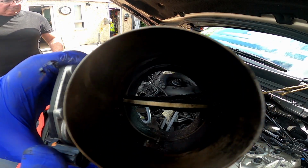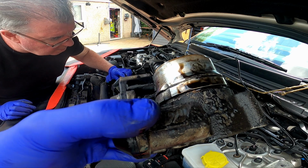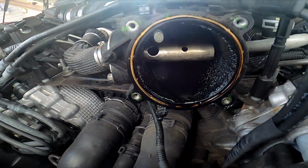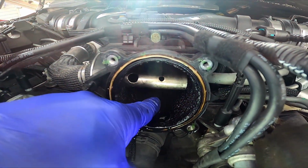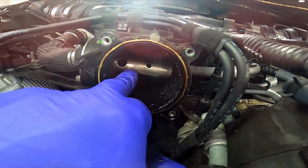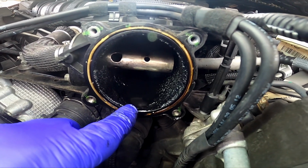If you can see that, quite oily, lots of carbon deposit on that side. Mother of mercy. So that's quite bad looking. And have a look in here, there's that light part, and that is oil. Now bearing in mind, that's the pipe we cleaned, that's the EGR return pipe, and we're just back from recording all the parameters when the engine was very, very hot, but that's horrendous.